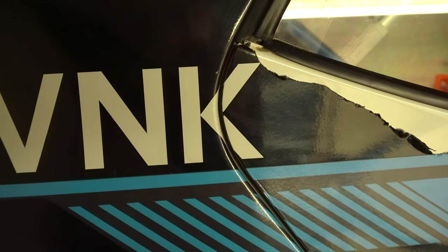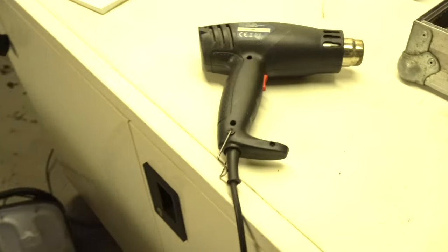I'm going to set the camera up so you're looking at this bit, and what we're going to look at is how close we should bring that heat gun to the vinyl itself so that we don't burn the paintwork underneath and we also get it off fast enough without wasting too much time.